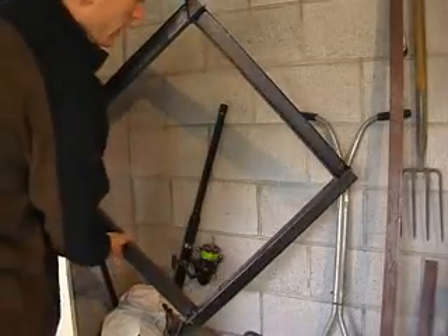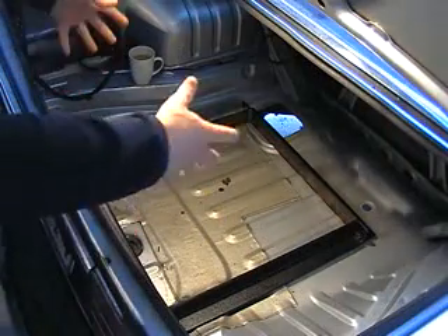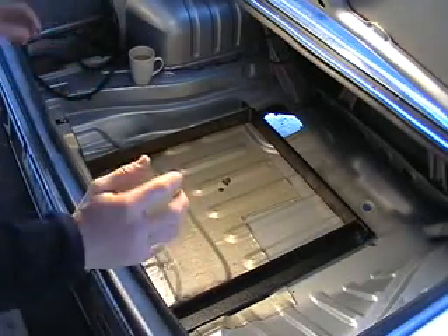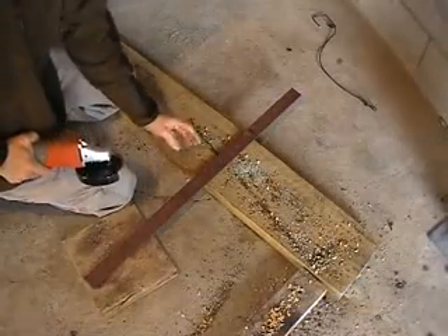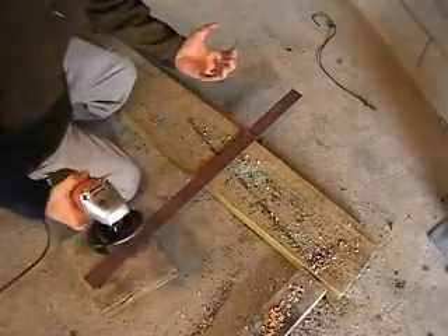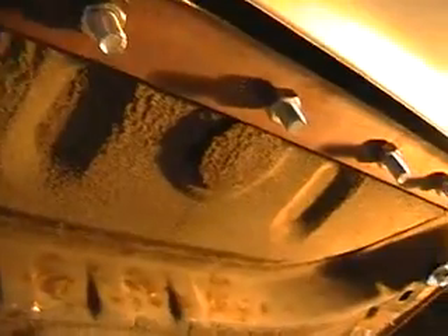Time to install the back racks — they've been resized, time to chuck them in. I'm going to have to put the rear rack closer to the back of the car because of the dips and holes in the back of the boot. It's not ideal for weight distribution but I haven't got much choice if I want it to be really strongly secured to the floor. I have some 5mm thick slices of steel which I'll drill holes in — these will be the anchors underneath to hold it in tight. The brackets underneath the car are bolted in 26 times; there is no way it's going to move. The rear racks have been installed at last.